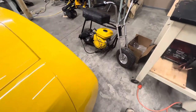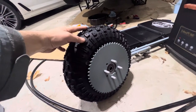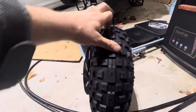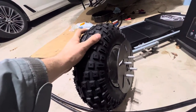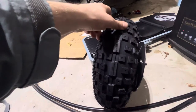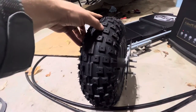I love the fact that the yellow matches the yellow. This is the tire setup I got from Go Power Sports — a 14-inch knobby tire with a 54-tooth sprocket, and on the opposite side I have a disc rotor, which is going to be perfect for that caliper. I just have to cut the studs down and get some spacers to fit it in there. With that gearing and 3,600 RPM, it should do 30 miles per hour.